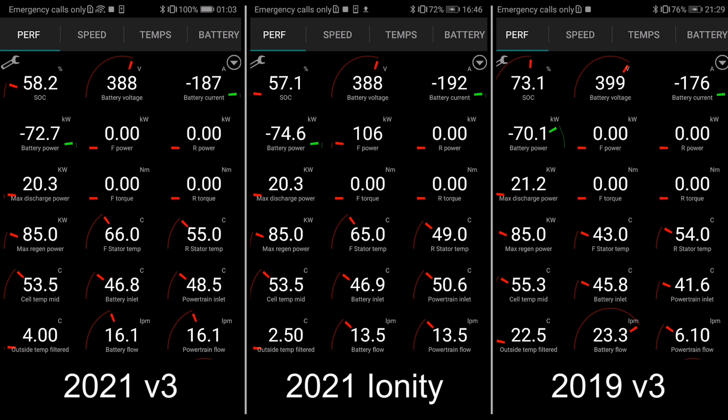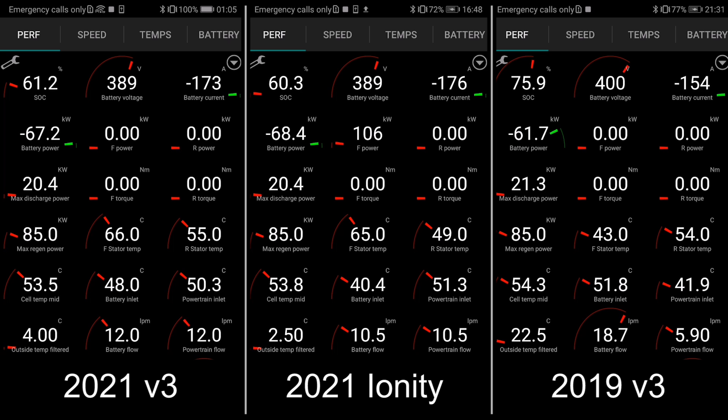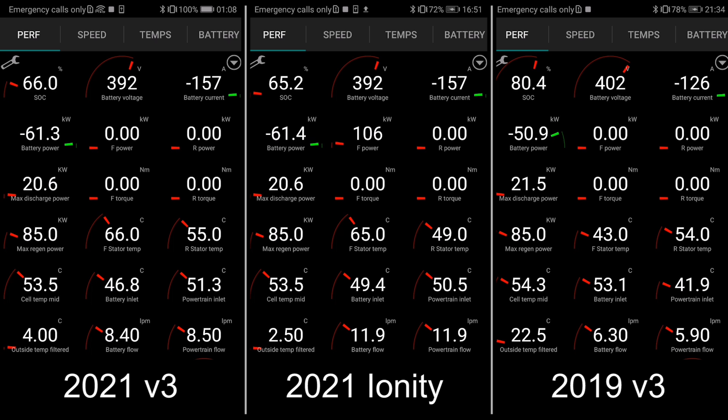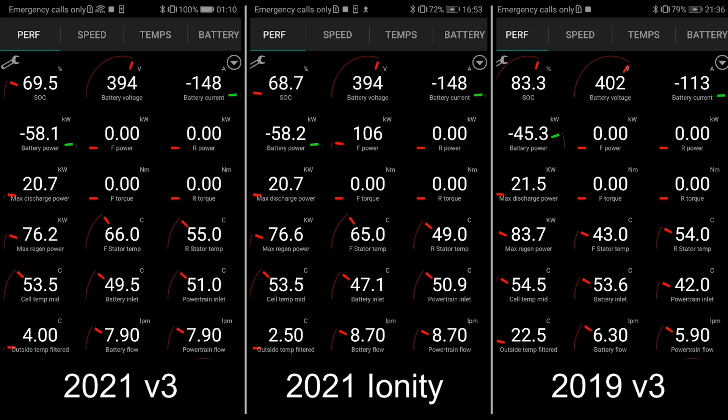This is quite apparent: the old car at 70% charges about the same as the new car at 58%. For those who don't know, there are many indications that this car has the slightly smaller LG pack, not the Panasonic pack. Some guy also claims that all the performance 2021 models have the Panasonic packs, which are bigger than 82 kilowatt-hours, whereas this car has about 77 kilowatt-hours. The usable capacity from 100 to 0 percent is around 70 kilowatt-hours, whereas my Model 3 when new had around 73 kilowatt-hours — so we're missing about three kilowatt-hours, but that shouldn't explain why this car charges so slow.